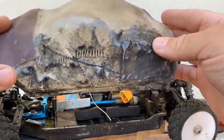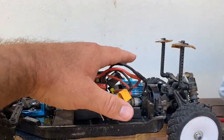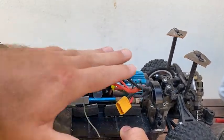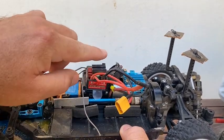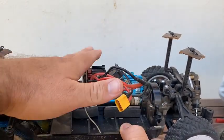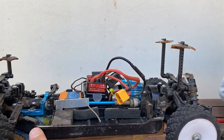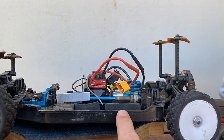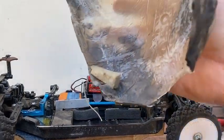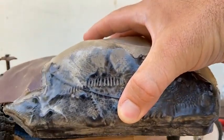It's made of fiberglass. So I'll just describe briefly how I did it. I got a piece of material, actually a bath towel, cut to shape here, and I laid it across all this stuff because I wanted it to be fairly close fitting, but I wanted a little bit of clearance between the cover and the components. So towel on first, then I put cling film, like food wrap, over the whole thing, and then I fiberglassed over that and put pieces of wood to hold it against the side of the chassis here. There's actually a little lip on the chassis here, so when this goes on, it clips on to the chassis, and it holds fairly securely.